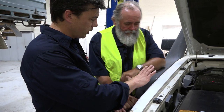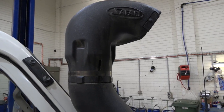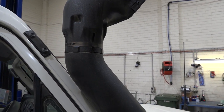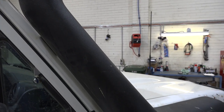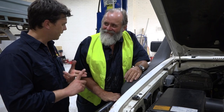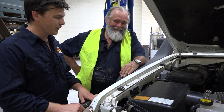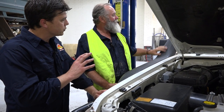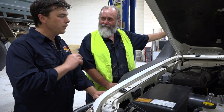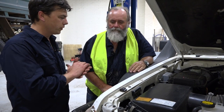So there's two things here. One is what you call the Safari R-Max snorkel — it's a bigger four-inch snorkel. The reason behind that is when snorkels were all designed 20 or 25 years ago, they were all for standard ECUs, standard programming, standard exhaust, standard turbo. But since then, everyone wants to put in a turbo, aftermarket exhaust, or a chip of some sort — we're talking a couple of hundred horsepower more than normal. So if you've fitted any of those accessories with a standard snorkel, things will be inhibited because they won't get as much air and volume as they need.